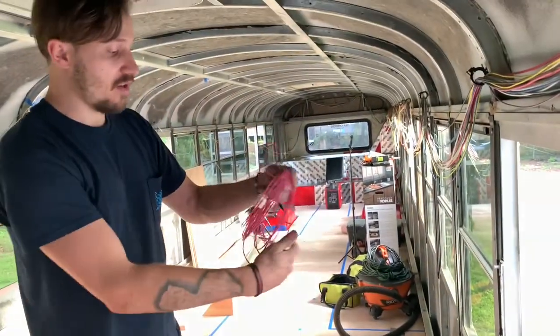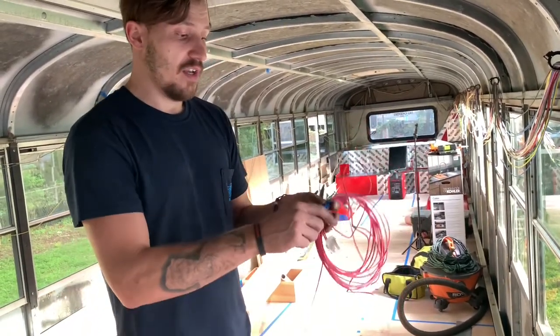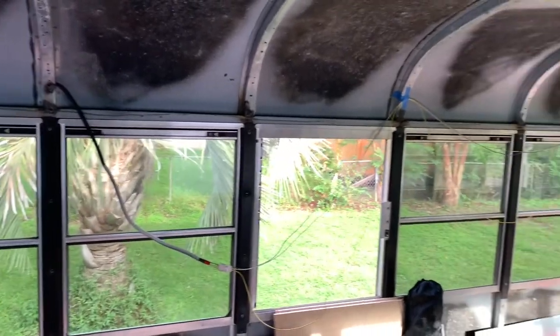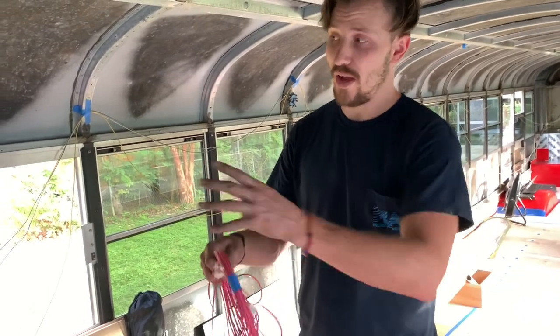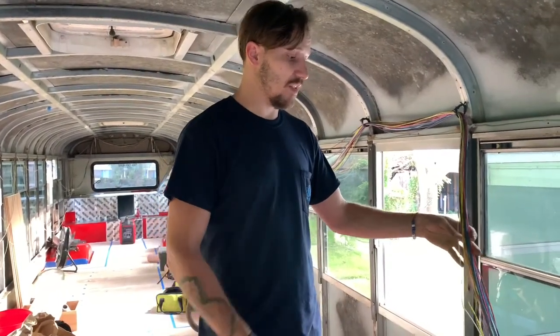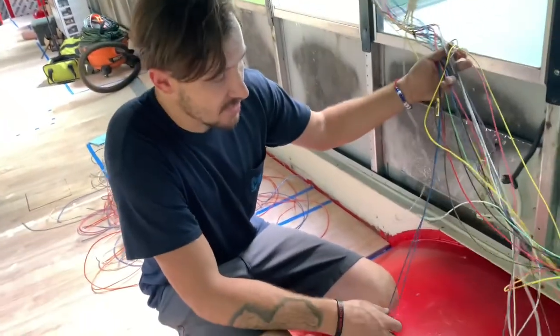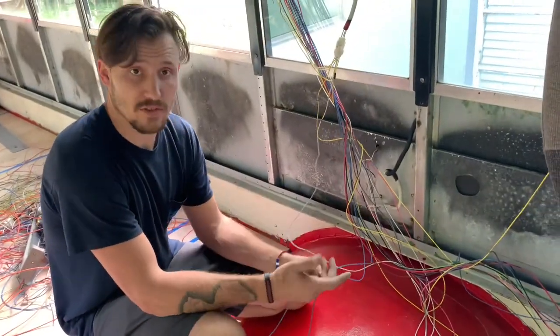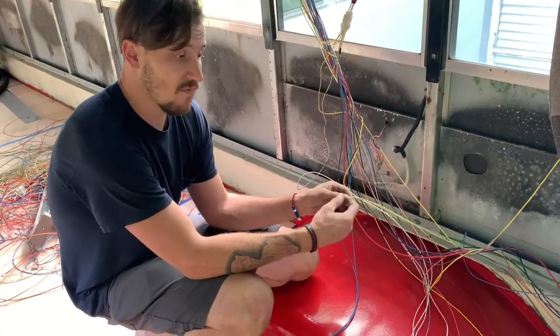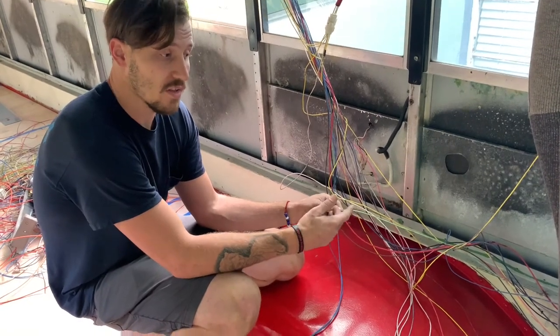On the other side of the bus, this was set up for speakers, which we took out. It started up in the front corner and ran all the way along the length of the bus. I knew it was speaker wire, so I wound it up as I went around, then double-checked with our fuse box to confirm it was a speaker or auxiliary-type wire and cut it out. A lot of your wiring is going to be tangled up unless you had a really good electrician. It is beneficial to have somebody else help you — that way you can tug a wire and they can see where it goes, and you can verify with each other that it's appropriate to cut out.